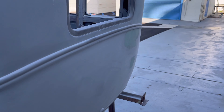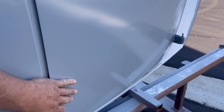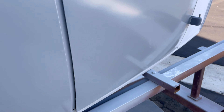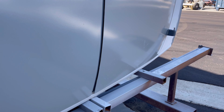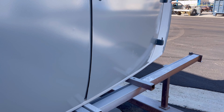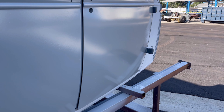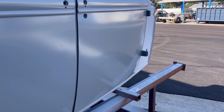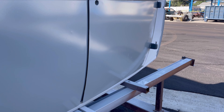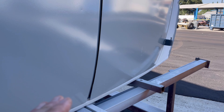On the passenger door, if you remember, I had to replace this big section right here. But as you can see, that door flares out a little bit. I wish I had fitted the door after doing the metalwork before doing the bodywork. I'm gonna need to bend that door in. I hope that doesn't crack the filler — if it does, I'll just have to grind it out and start over on the bodywork. Best to get it now because I want that door to come in and sweep in nicely — it's a little proud of the edge.